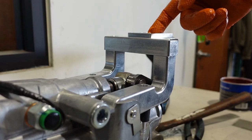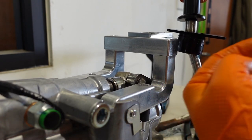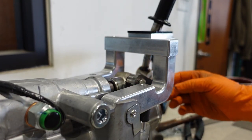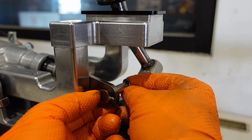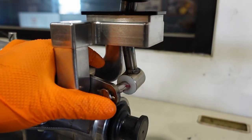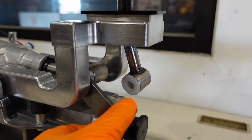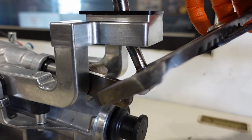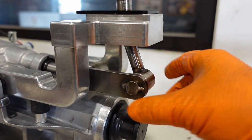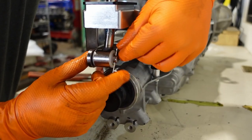Drop the shifter into its base — note the bend at the bottom of the shifter faces the rear of the transmission. Set it into its bore on the shifter base and, while holding the black bracket clamp on both sides, apply even downward pressure to seat it into place. Install a washer and lube the fixed pin on the link bar, then partially install it into the shifter fulcrum bushings. While holding the link bar by hand, push the shifter forward to lock the transmission in third gear — this gives you the most room to pop the link bar pin into place. Squeeze the pin with large channel locks until it pops into place, then install your washer and cotter pin.